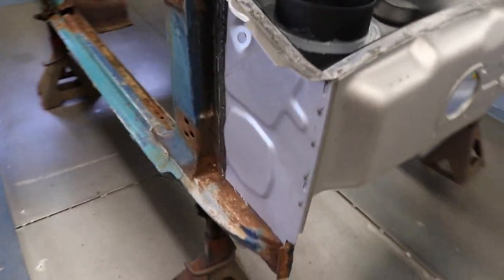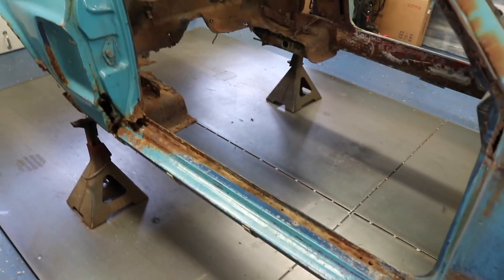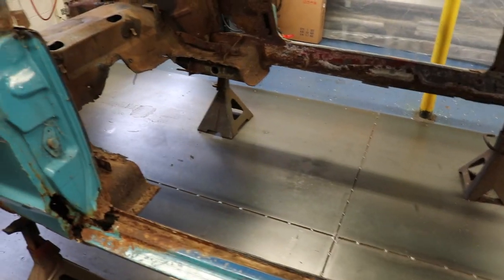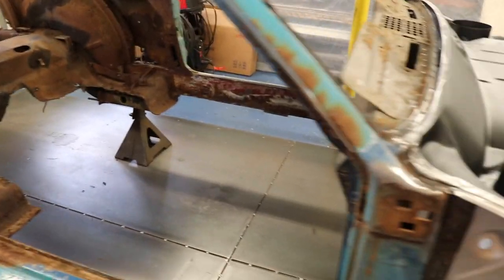And also in the next video, I'll start working on removing the pillars, A and B pillars, from the rockers. I believe I'm going to brace. I have some door bars that go in between the pillars to brace it, and then I think I'm going to cut out both inner and outer rockers and then transfer this whole body onto that new floor that I have.